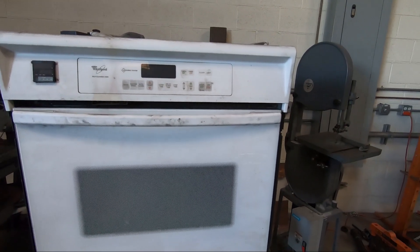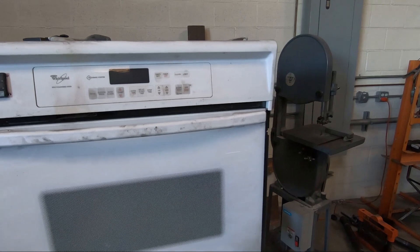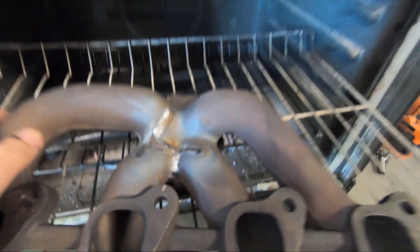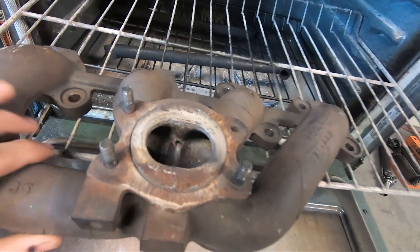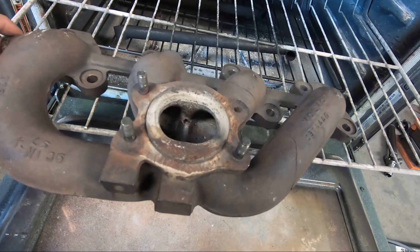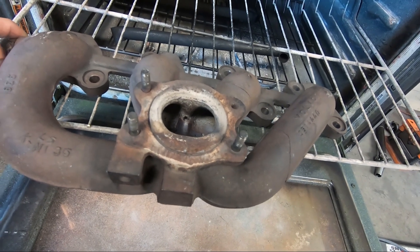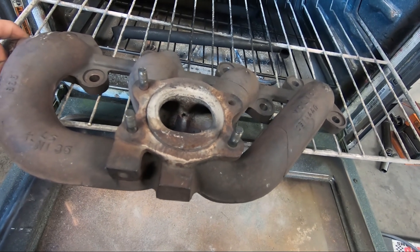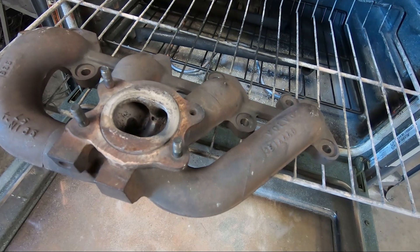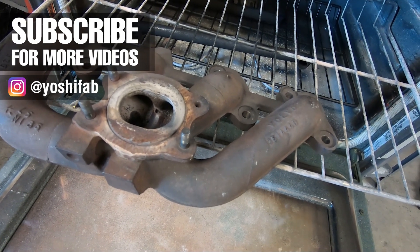It's the next morning. I left last night around 9 o'clock and it's 8 o'clock now — this thing's been sitting in the oven with it off all night. The welding all looks good, no cracks. I think we're good to go — this is ready for the customer to pick up. This is something you can totally do if you have a TIG welder, the NI 99 rod, and a way to heat the manifold up. I've done MIG welders, stick welders, and all that, but TIG is by far the most consistent. If there's a good welding shop near you, have them do it — or check the link in the description, we offer the service. Thanks for watching; please like and subscribe.